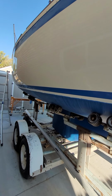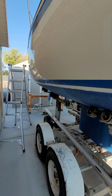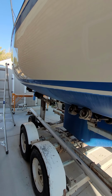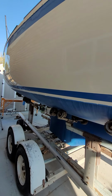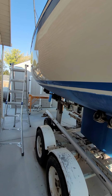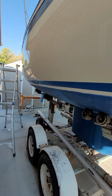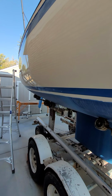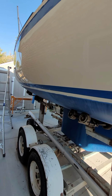So a couple things I want to talk about with this paint. This stuff is a one part poly paint. When I applied this, I used their Total Boat foam rollers with their recommended Red Tree 3-inch badger hair brush. I did a roll and tip with each coat.